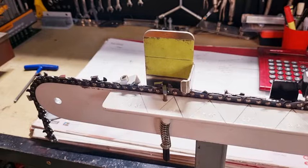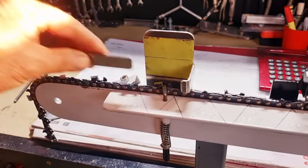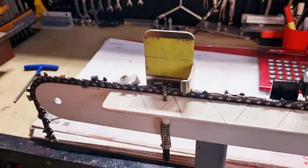So if you were to measure your tooth and it was 8 millimetres in length, you would have to take off 0.2 mil extra than what it already is at 0.65. So then it would be 0.85. And so on until you get to the end of the life. If you get to the end of the life of the tooth, which is approximately removing 7 millimetres of tooth, you'll remove 0.7 of a millimetre by the time you get to the end of the line, the witness mark. So if you're already removing 0.65 of a millimetre and then you add 0.7, that's 1.35 millimetres. And all you've got to do is use a straight edge and put the feeler gauge underneath, file, check. Sure, it's a little bit slower, but you can do it that way.